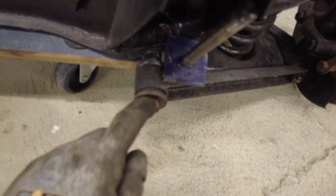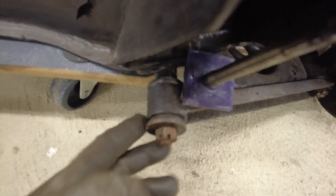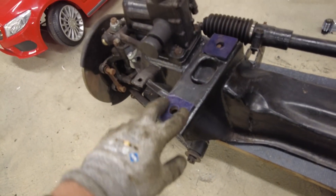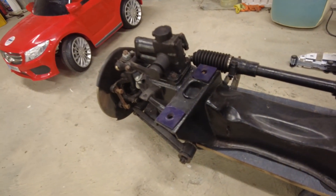It's going to stay in there - I can see myself causing a whole lot of other problems by continuing down this course of action. The only nuts that aren't tight are these lads here, and the reason for that is simply because you tighten these when they're actually installed on the car. I'm just looking - that bushing is actually cracked already. I mean it hasn't even been used. You just can't get modern rubber components that are of any decent quality.